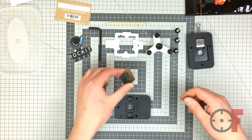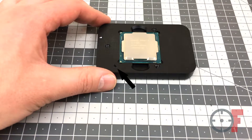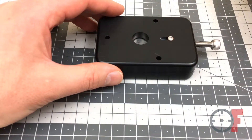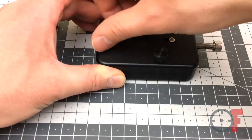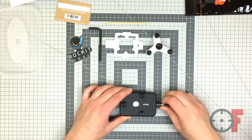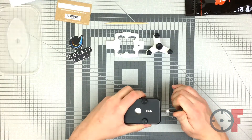The whole procedure is pretty simple. I had to insert the CPU in the bottom part of the delidding tool — there's a little triangle that helps you align the CPU. After inserting the CPU in the tool, I put the top cover on, making sure that the little metal plate is fully recessed, then locked the tool with three bolts and finger-tightened the side bolt. Next, with the supplied Allen key, I tightened the side bolt.